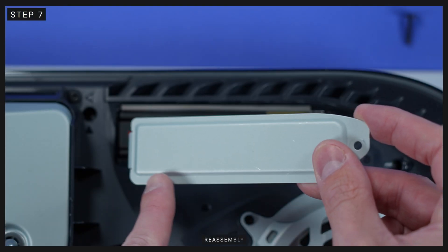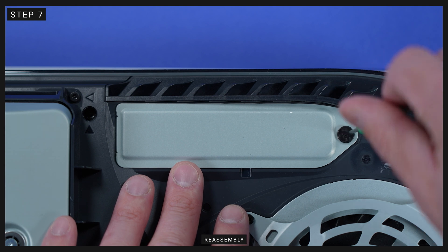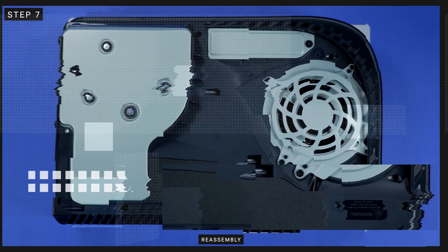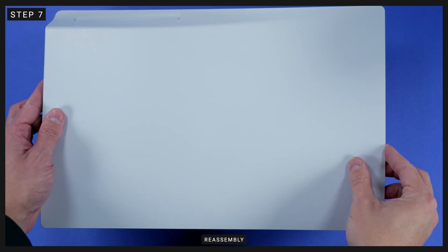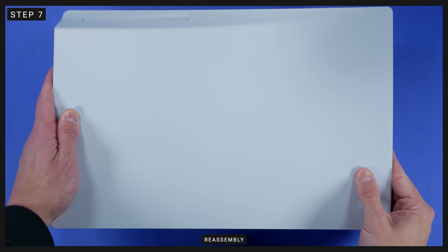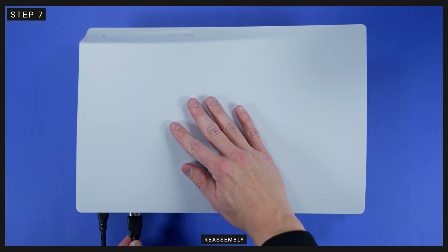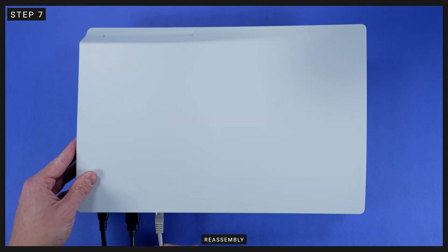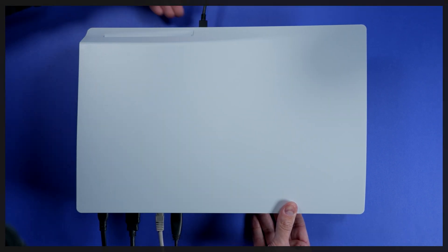Step 7: now we're ready to put this thing back together. Reattach the expansion slot cover and re-secure the PlayStation screw. Position it slightly on top of the edge and slide it back into place — you'll hear a click as the cover is secured. You're now ready to connect your power cords, cables, and if you are using the vertical base, you can reinstall it at this time as well.